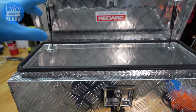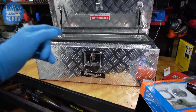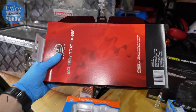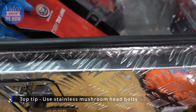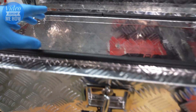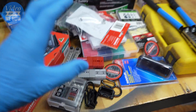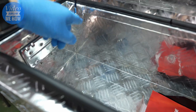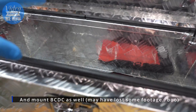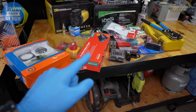There's going to be a little bit of prep we need to do to our battery box — our all-in-one unit — before we install anything. We need to install our battery tray, which goes in just down the bottom. This back wall is where all our bits and bobs are going to go: the monitor, shunt, fuse blocks — all of that will live there. I'm going to be using some marine ply, so the first step is to prep the box ready to mount down the battery so we can start installing the BCDC.